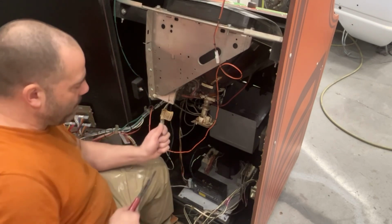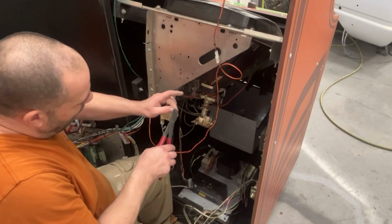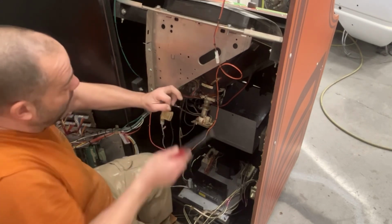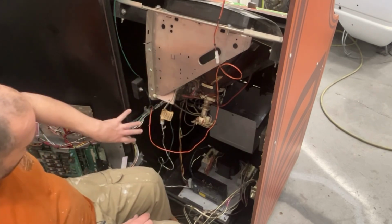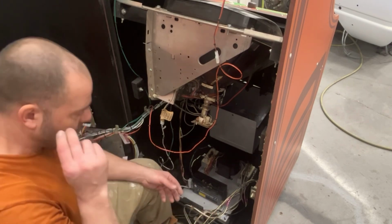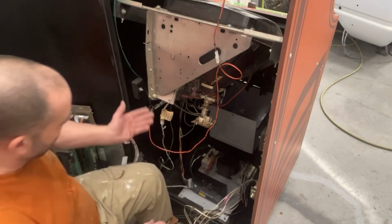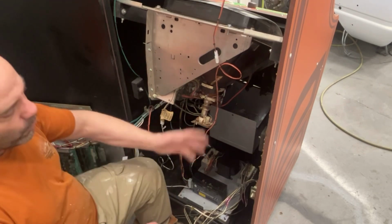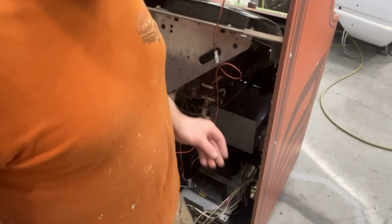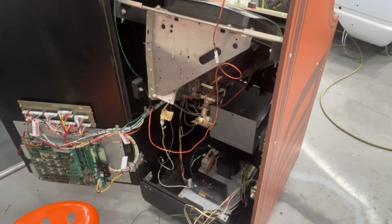I was messing around, and the games were turned off. I was putting those flash drives in there, and there were some wires in the cabinet that I did not notice. They were just sitting over here. Well, I finished putting everything in, I fire on the game, and it's just a huge spark. Somebody had live 110 power wires hanging in my cabinet, and they hit the circuit board and ruined it. I had to find a whole other circuit board, all because somebody was lazy and left bare wires sitting in the cabinet with no tape, no cap, no nothing.